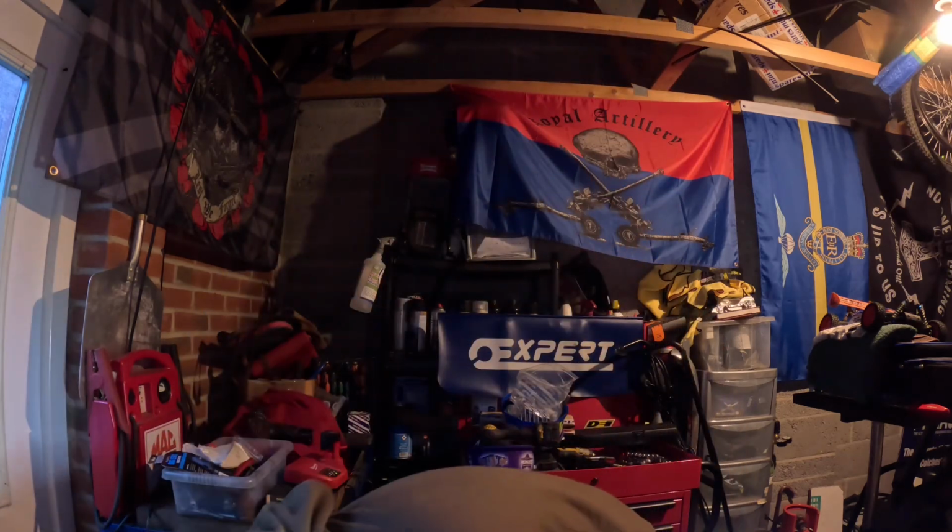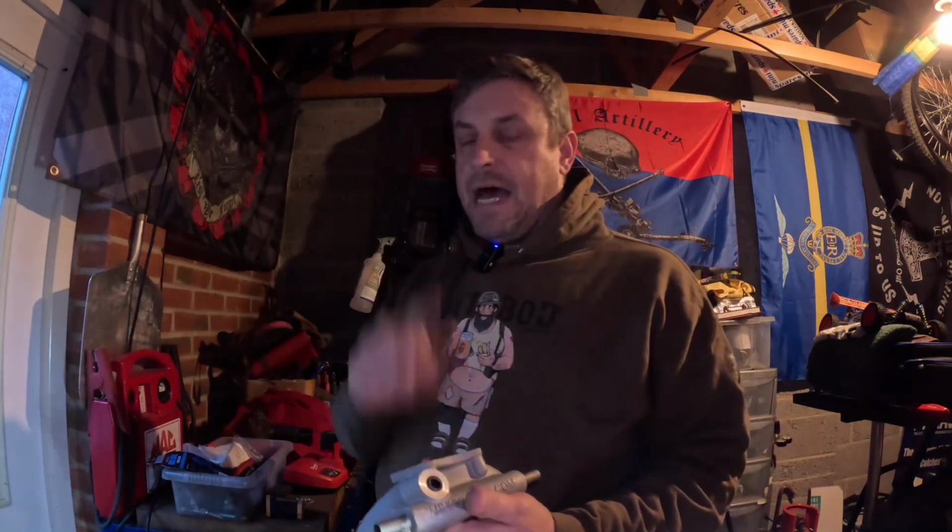It needs sorting. What did I port matched it with? A gasket. So we're going to just open them ports up a bit. That'll provide better flow. I will keep this on the shelf. As I've said previously, I may remove the supercharger and just go back to a normal carb or whatever. So this will be useful to have on the shelf. The exhaust I'll be running is a 3 branch, long centre branch, LCB, that will stay. It's only the inlet that's different. So that's what we're going to do. Now it's a mod for a potential future incarnation, if you like, of the engine and the running gear. We'll see. So I'll do that and then I'll report back to you guys.